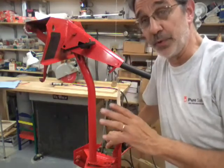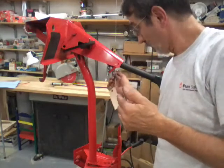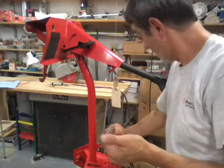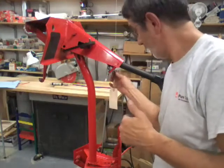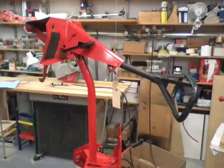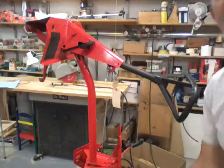Now we'll go down and try to get all the wires hooked back up for the ignition switch. When you turn it to the off position there's a kill wire; there's an on wire; and there's a start wire that goes to the solenoid. We've got to get them in position — and it looks like a ground wire too. Let's drop the camera down and put them on.